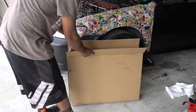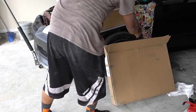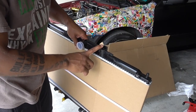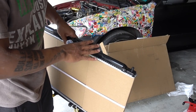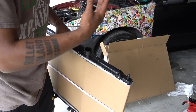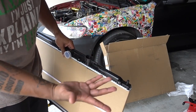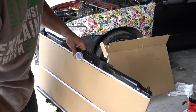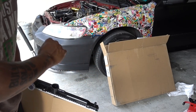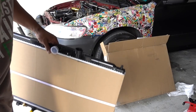You can get this radiator from Amazon. It doesn't come with a radiator cap, so you'll need to replace that, but if yours is still good you can reuse it. I also recommend replacing the thermostat while you're in there — I did that a few months ago. Another thing: check your hoses. Make sure they don't have any cracks, and if they start swelling up and getting big, the hoses are bad and need to be replaced. Mine are good.